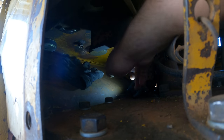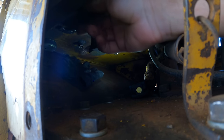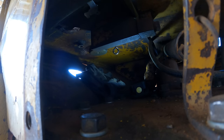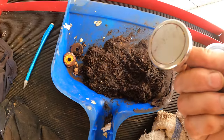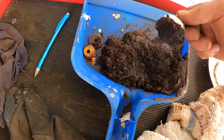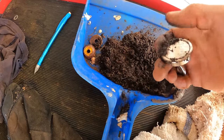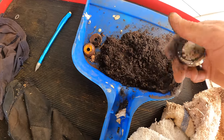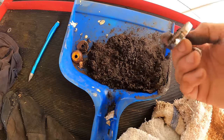Ready to put the petcock back in, but this reminds me — I had these magnets on here and from the inside I did not see any evidence of them doing anything. When I first opened the tank I expected to see concentrations around those magnets, but you couldn't see any evidence of them from the inside. Speaker magnet, hard drive magnets, and the other magnet. Here's all the junk that was in there, dried out — it's just bits of rust. This stuff is somewhat magnetic but not crazy magnetic. This magnet is way stronger than a hard drive magnet so it's not sticking to it that well. Through the tank it didn't make much of an effect. I think putting a magnet on is a good idea — still worth doing — but it's not always going to help you that much.